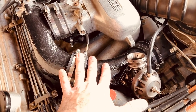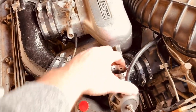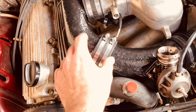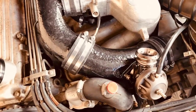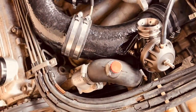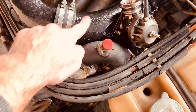The V2 kit fits closely, so there's very little gap between these components. The orientation of this valve is very important — make sure when you put it on that these two parts are parallel and these two are parallel as well. One indicator: check if you have a gap here — you should have just a few millimeters of gap. If this is touching, it's turned the wrong way. Also don't let this clamp touch there, because vibrations will cause it to dig into that part.